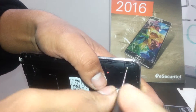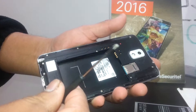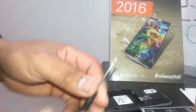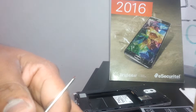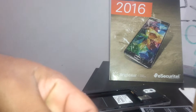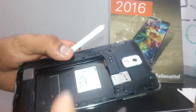You're going to remove all the screws using a Torx T6 size screwdriver, and we may need a flat-end screwdriver as well. You can also use a plastic opener — it's up to you. I'm going to use this flat-end screwdriver. Once we remove every screw and the SIM card and the stylus pen...